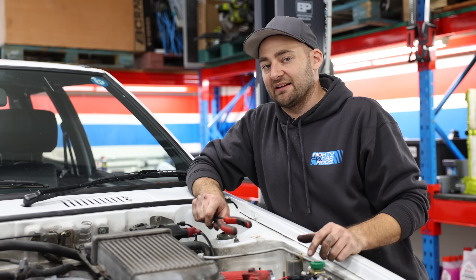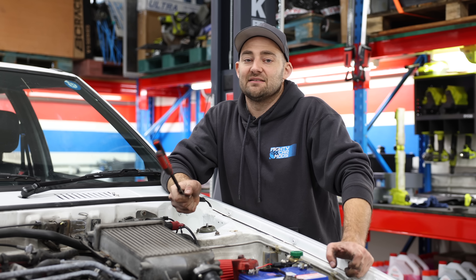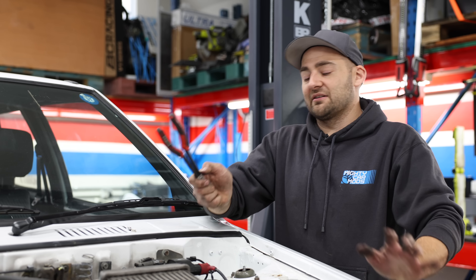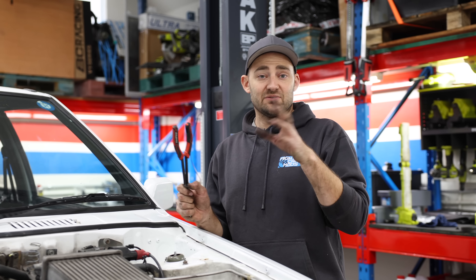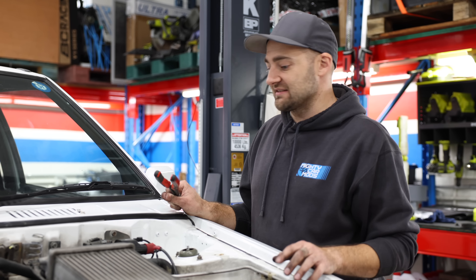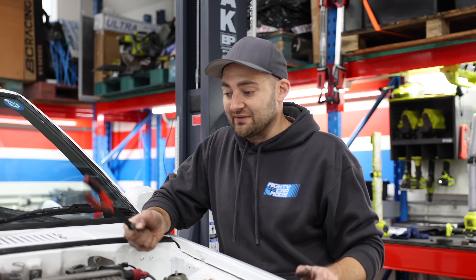That's done. You've got to pull apart basically half the engine bay to get to the fuel filter, but it's done and that fuel was so gross and brown that I'm very glad it's been changed — I may have to change it again depending how that goes. An upgrade for this car is Nissan Pulsar brakes, N14 or N13, but you do have to mess around with spacers and find the calipers. In the meantime, I've got reconditioned rotors with enough thickness left, and pads from a CA18 180SX. I'm going to put in new pads and machined rotors, then the brakes will be done, and we can start it. The exhaust is the only thing I'm waiting for — I can't get the V-band to adapt properly yet.